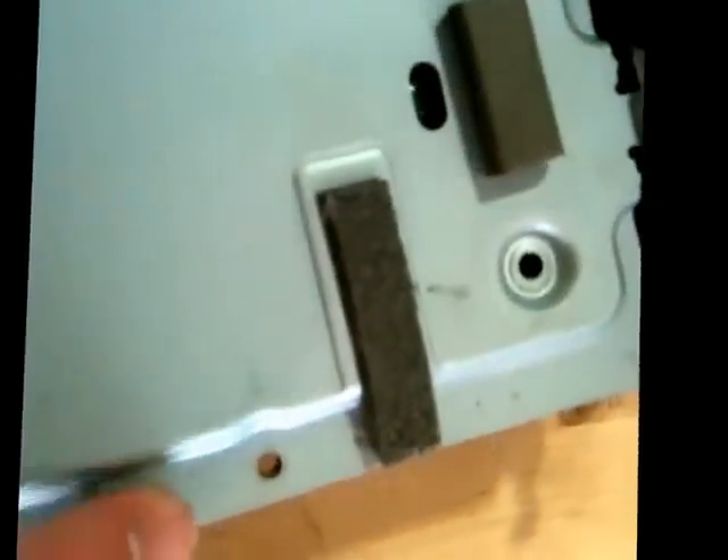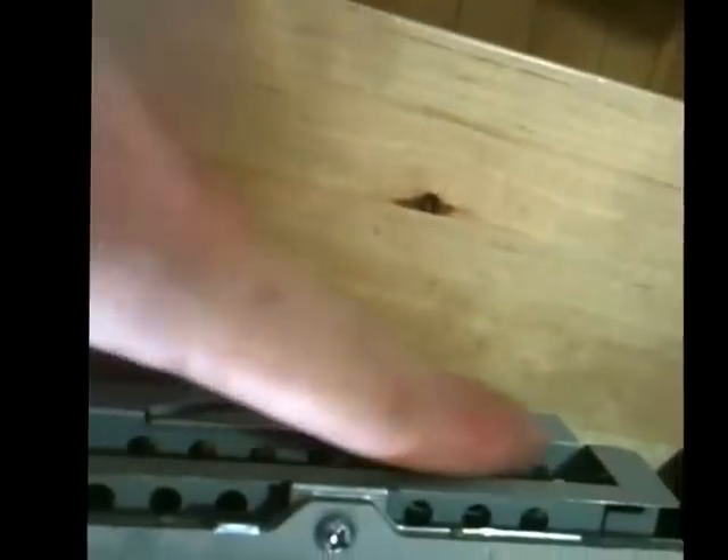These screws have nowhere to actually screw onto any of these little screw holes — it's just empty space underneath here. That's because they actually attach to the back case. So the next step is to seat it back into that case. We're going to pick this whole piece up directly and just set it straight down in there. The piece you want to watch to line up is the bay that the hard drive is going to sit on — it's going to line up with this piece over here on that side.